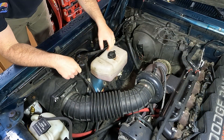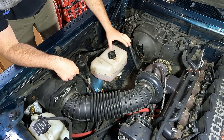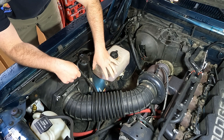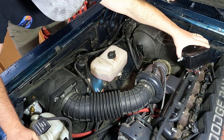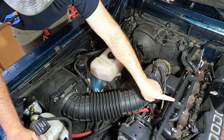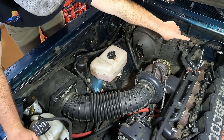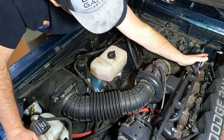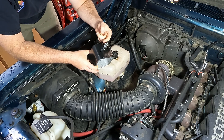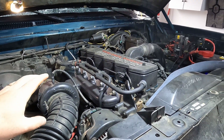My plan today is to move the washer fluid reservoir as far towards the firewall as possible, and then my oil bypass filter will nestle right here clearing the wheel well with the bracket. My idea with the extra valve cover is to either have it at cylinder number three so the line will run in-line over here, or for cooling potentially cylinder number six if my line is long enough coming around and up into number six. One thing I made sure was that we welded the bung high up so that it clears your fuel lines.